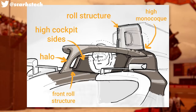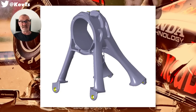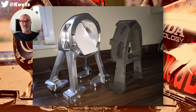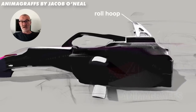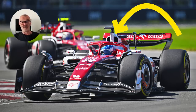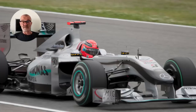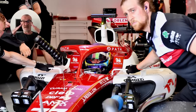You end up with a much better roll hoop shape from both a structural and an aerodynamic point of view. This titanium component is mounted on the monocoque — the carbon tub the driver sits in — and is actually bonded to the tub, which is much stronger than a mechanical fixing like bolts when mounting to composite materials. Roll hoops come in two main designs: the table-style, with four legs going up into a hoop bonded and bolted to the monocoque just behind the cockpit; and the blade-style, as run by Alfa Romeo, which is a little lighter and aerodynamically different.